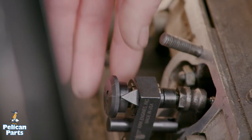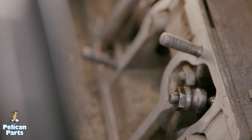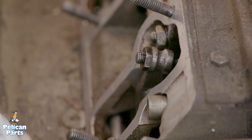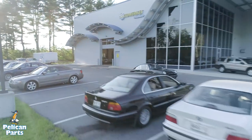And that's all it takes. Remove the Kirk tool and wrench from the engine. Check the rocker arm for lateral movement — it should move side to side very slightly. A 0.1mm clearance is difficult to feel, but some motion should be detected. Man, I love that tool. It's been fun. Hopefully I'll see you on the road. Until next time.